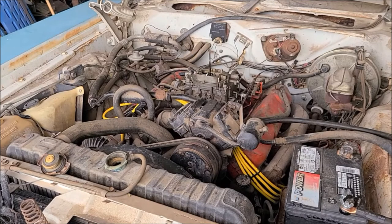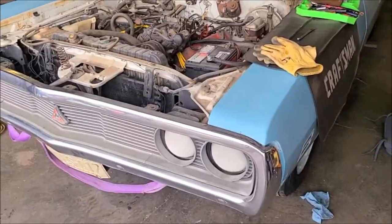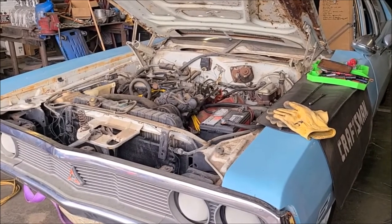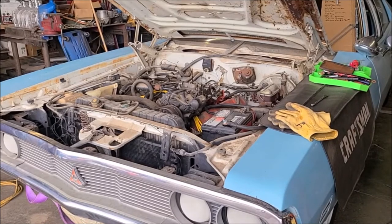Another thing to note, I don't know if it's the newer 727s or just the older ones, but my '65 Coronet, you got to start it in neutral if it's been parked for a really long time, so the transmission can pump itself back up. So I don't know if that's the case with these newer ones, but I've got it in neutral when I'm starting it, just in case. But I might put it in gear here for a second too. Let's move the camera back a little bit and we'll see if we've got any forward or rearward, if it'll go forwards and backwards. I've got the wheels chocked, but we'll still see what it does here.